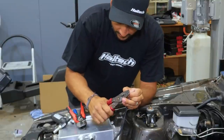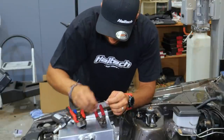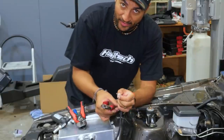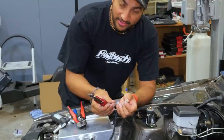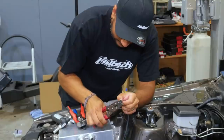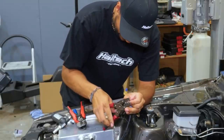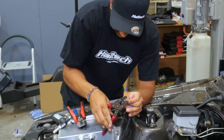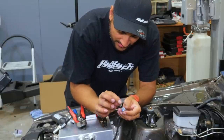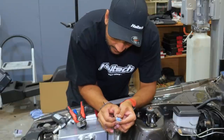Take your pull-to-seat pin - there's no rubber grommets that go on the back of this one because the connector has already got one on the back, so it's one less thing to worry about when you're already trying to think a couple of steps ahead. Make sure those crimps are done up nice and tight on the actual copper itself. Always try and keep your pin that you've just done out of the way - you can't tell you how many times I've crimped a pin absolutely beautifully, gone to crimp the next one, and somehow got the first one tangled up in my crimper and mangled it. Try and keep it out of the way, otherwise you're just making more work for yourself.